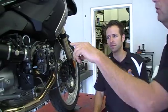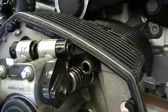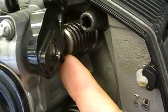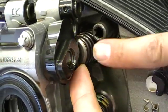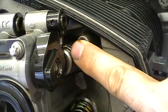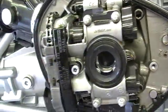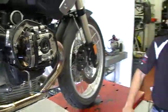Come on in here and zoom in — I want you to point to that. So basically you remove this clip, measure down in here, and there's a shim on the inside of the follower, right underneath this. So your shim goes right down in between here. Very interesting. Hey, this is great information and we really appreciate it. Thanks for tuning in to GoAZ Motorcycles at Louie's Garage. Thanks Louie. Thanks Mark. Take care — always a pleasure.